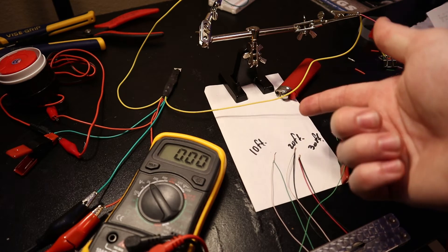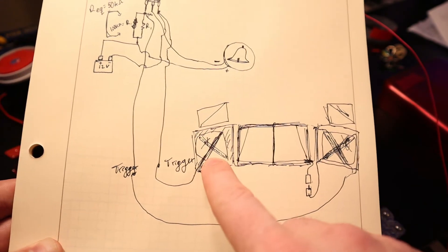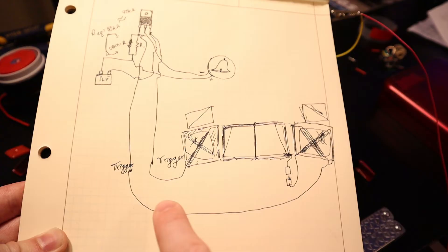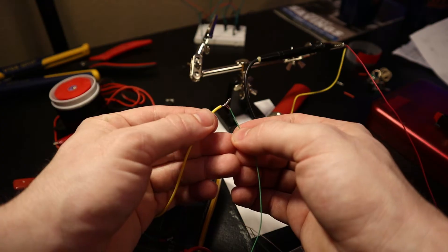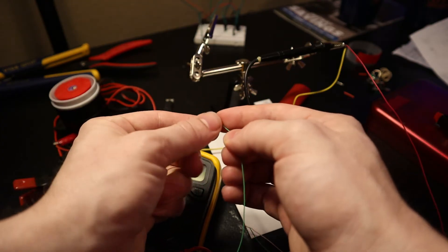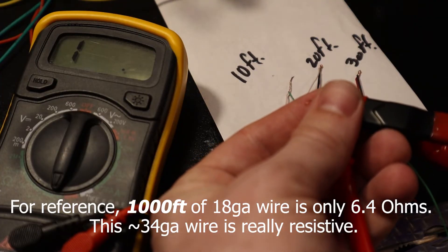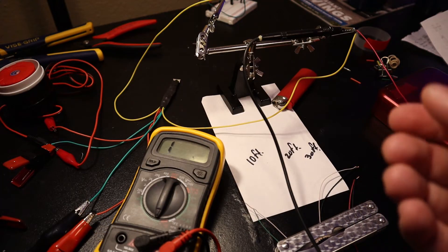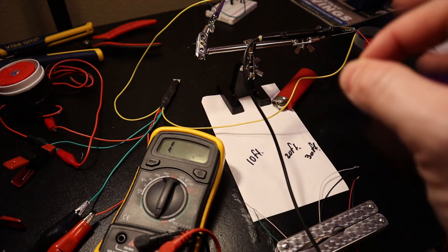The device works great after I got everything prettied up. However, while looking at my extremely professional wiring diagram, I worried that the length of wire I'm going to have to run to the three windows is too long, and the gauge is too small — creating a voltage drop great enough to set off the alarm prematurely. But after running 40 feet of wire and connecting it, the alarm's not going off. I checked on my multimeter and found there's about 9 ohms of resistance through this 40 feet of little tiny wire. Since this is next to no current going through the siren, I'm good.